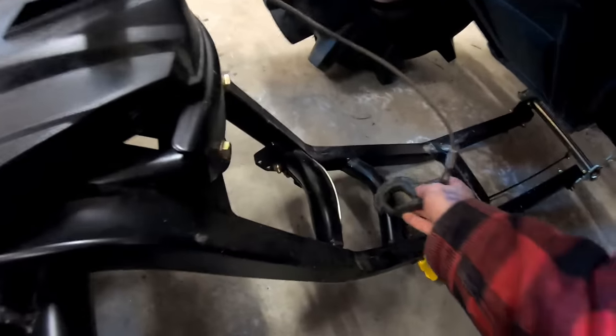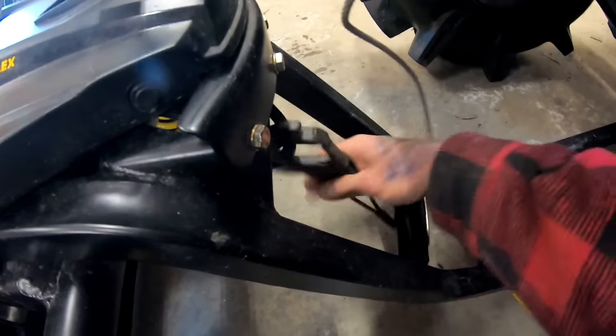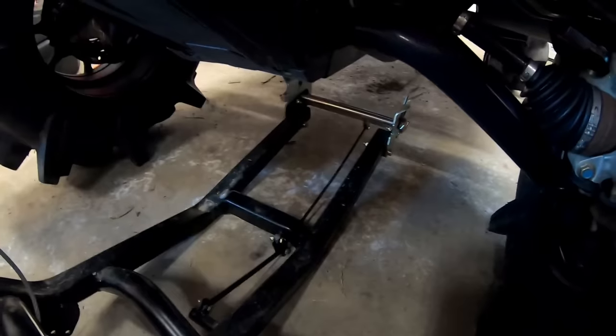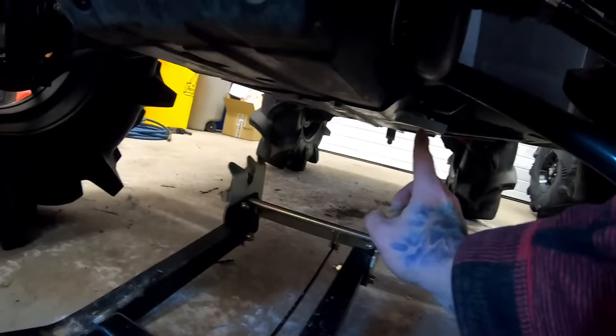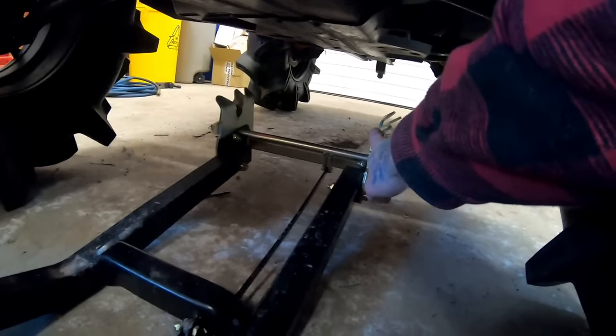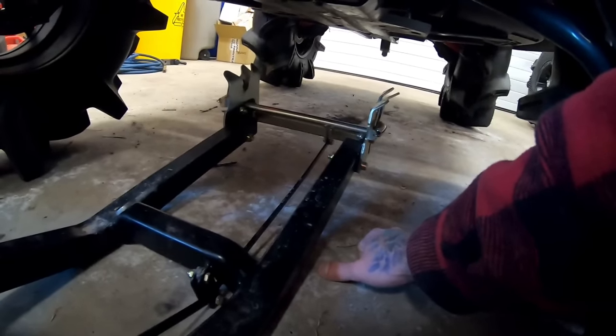So like I said, just grab your hook underneath the wear strip and then you just clip it in like so. And back at the other side there's my winch plate at the back that just has two prongs, and this little guy here gets guided in and snaps on, and it's good to go. You just got to make sure those are clipped, and you can start plowing.